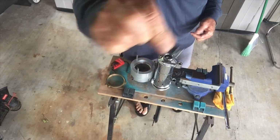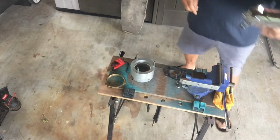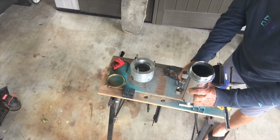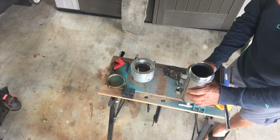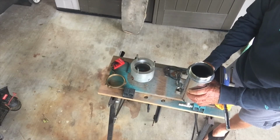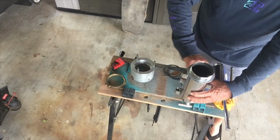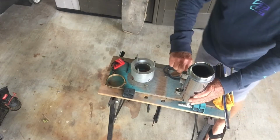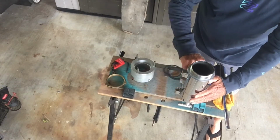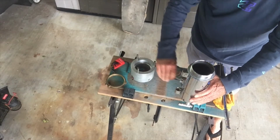And then I just use the same little brew head bolts. I put a little gasket on those. Those are actually the ones that go on the steam wand, but just because of the thickness, this will hold it good, and you have a little flex with the rubber gasket, so it's nice. It lets you tighten it down pretty good, but gives you a little bit of leeway, hopefully, because you don't want to bend that. I have bent that part of the boiler before, so I'm just going to tighten those down, and then we'll go ahead and see if we can get that base on there.